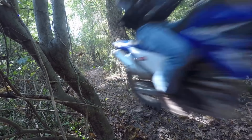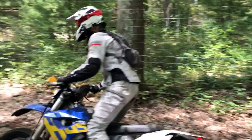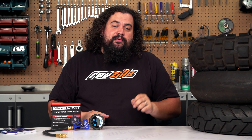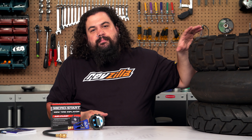and feel free to drop a couple pounds beyond that to see what gives you the best grip levels on your motorcycle. Now, for those who are on dual sports and adventure bikes especially, it's very important to remember: if you did not truck your bike to the trailhead, you do need to put street pressures back in those tires when you head back out.